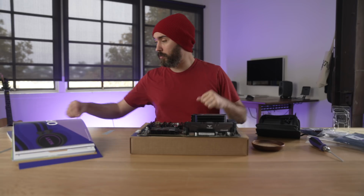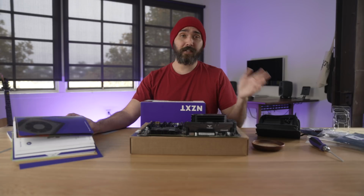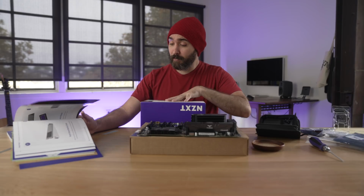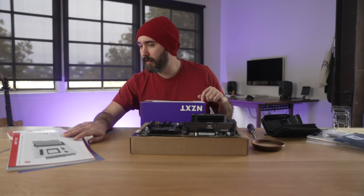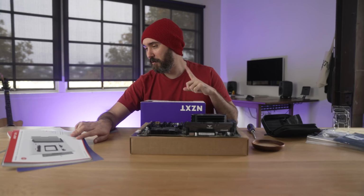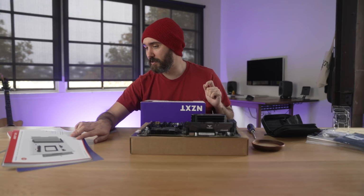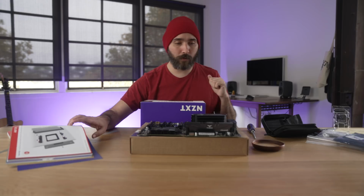Installing the CPU cooler. This level is divided into 2 different versions, 4A and 4B, depending on the type of cooler you're installing, because obviously those work a little differently. Because I'm using an AIO cooler, I'm gonna go with level 4A. Prepare the motherboard. Important, the M22 AIO cooler came pre-configured for an Intel CPU, which is not what I have in here, so I do have to take these extra steps. Remove the stock AMD mounting bracket and backplate from the motherboard.